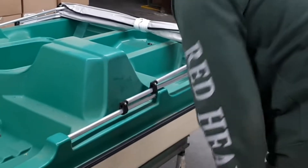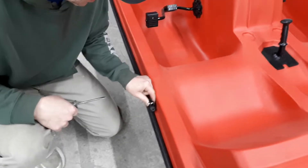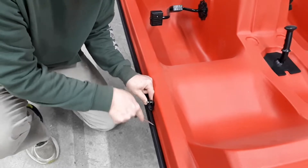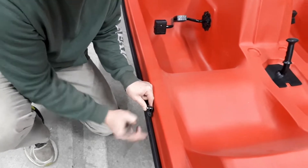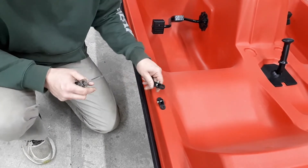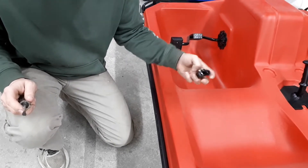That doesn't have to be screaming tight. I'm going to do the same to the other side. So back to the shorter boat that's 77 inches — your bracket is going to be screwed right into the trim and the plastic underneath the trim. If you go just into the trim, the screw tips will not come down through the plastic. If they do, no big deal — it won't leak. But if you're installing it on ones with actual slider bars, these here are just fancy little extra pieces. Don't be alarmed.